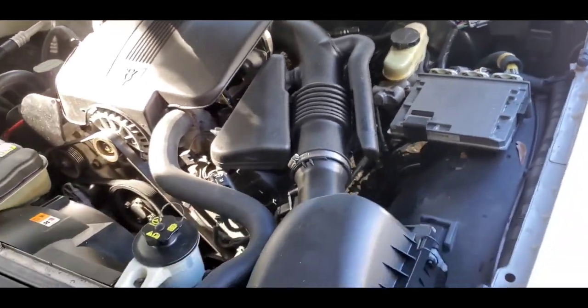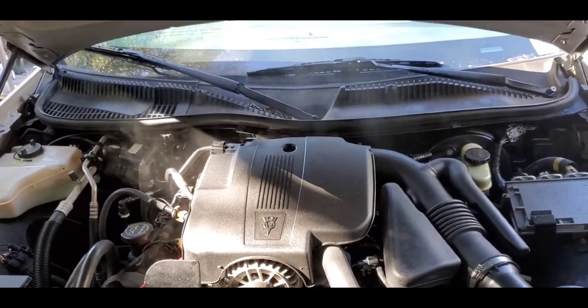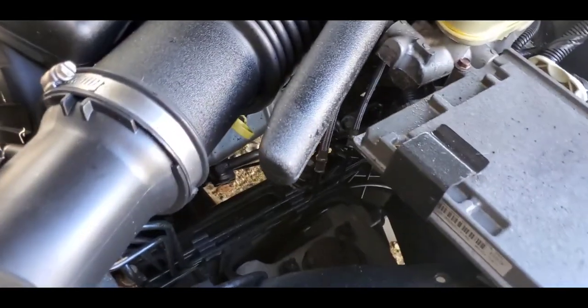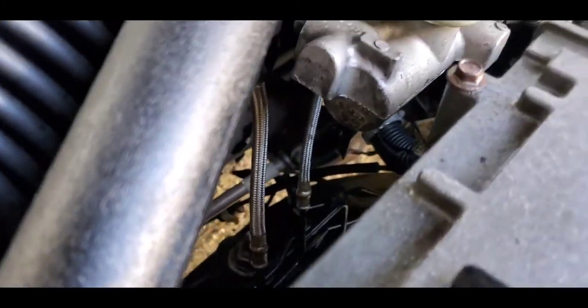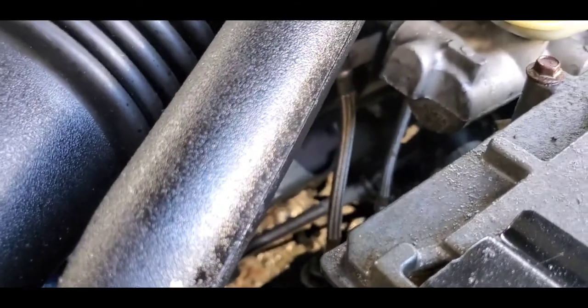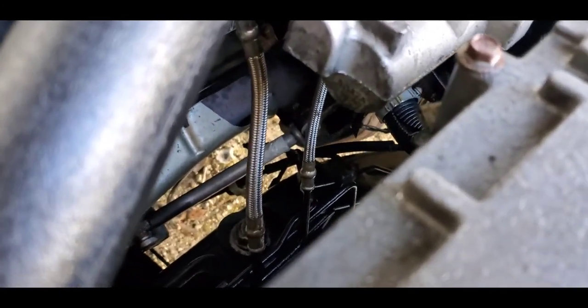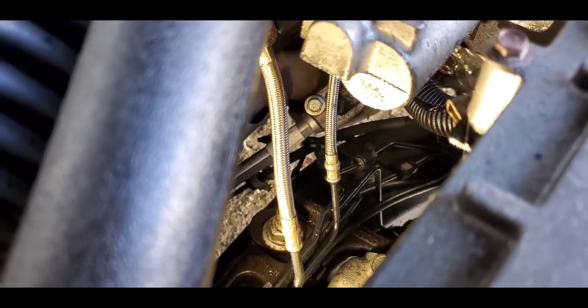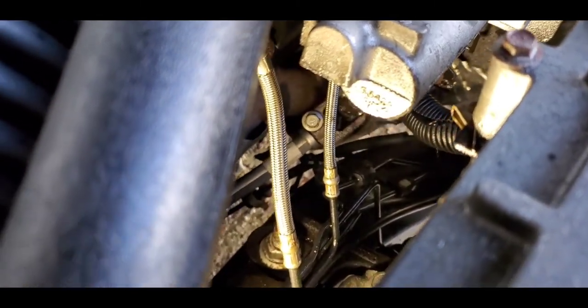See, this is what happens when you spray a bunch of Blaster and the exhaust manifold is right behind it - you get a bunch of smoke that you can't even see through, and it's worse than it looks on camera. I'm going to articulate that around where the bolt is easy to get to, and I'm going to try pulling that arm down. After I get that bolt out I'll try pulling that arm in that direction and see if I can get it out of that u-joint. Then I'm going to flop that u-joint around and see how stiff it is - that'll tell me everything I need to know. I've got that bolt looking right at me, staring right at it, so I can get right to it.